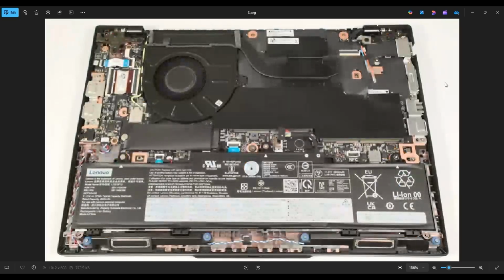After removing your bottom case, this is what you're looking at for the inside of your computer. Now, as a general computer repair side note, whenever I'm working on a computer in my shop, it's sitting on an anti-static mat. Either that or an anti-static bracelet are great ideas to avoid damaging things in your computer when you're working on it.